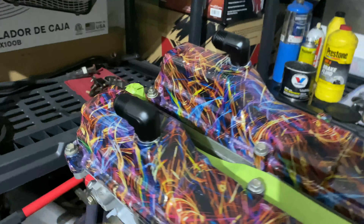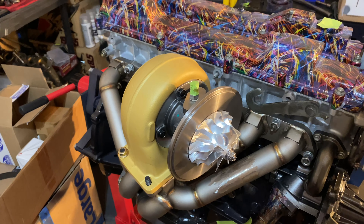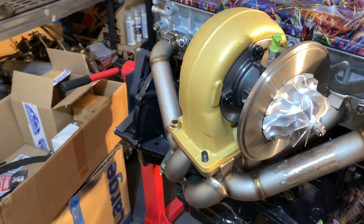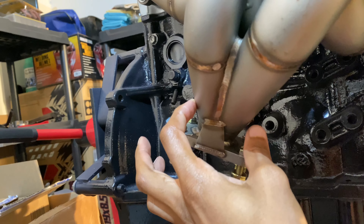Sorry it's so messy in here — I just got back and had to start messing with this car. Here's my turbo: it's an eBay turbo, I think it's VS Racing or something close to that. It's basically a BorgWarner S300 series — the 369 replica, I'll call it. Supposedly it's dual ball bearing, billet wheel, and it's dual scroll / twin scroll. My manifold is twin scroll too. I think it was like 700 bucks. I had the rear housing Cerakoted while I was gone.